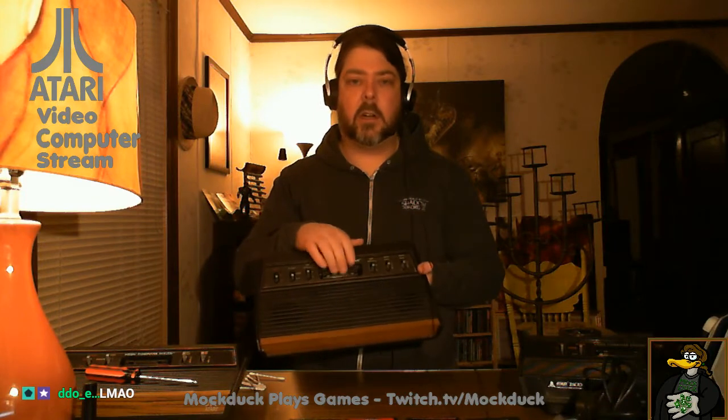What do you need to do to take an Atari apart? First off, is it dangerous? No, it's fine — there's nothing that's going to kill you inside of this thing. I recommend that just about anybody do when you first get an Atari is give it a good clean. You need a Phillips head screwdriver — that's all you need. There are six screws you're going to need to undo. Leave these two for now; those are what keep the circuit board to the bottom case. You've got one on each side and two in the front area.